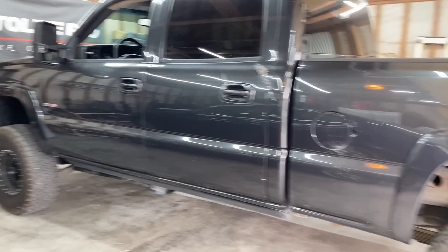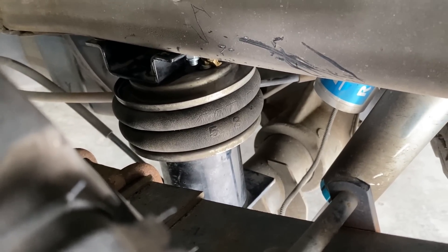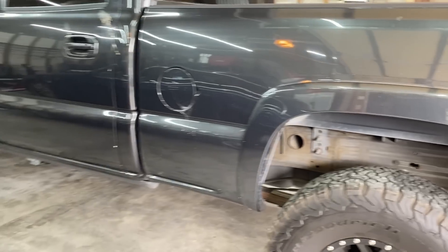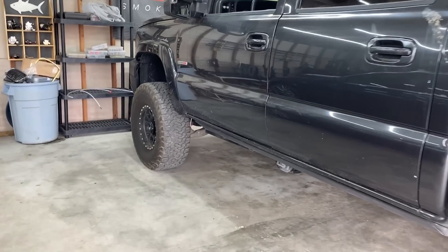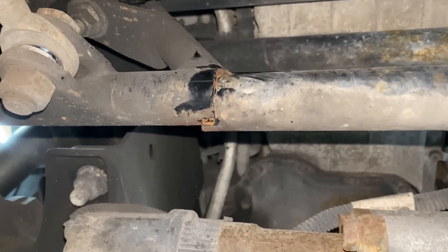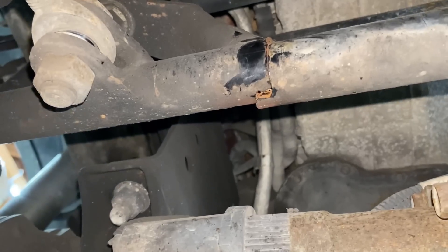I would call that a good day. I'm happy I got those airbags back in the rear end — the truck is actually sitting a good bit higher. I have those bags with zero psi and they are completely collapsed and sitting flat, so it might actually affect my down travel too. But it's a tow rig now, and she's going to be getting used to haul trailers, boats, and all kinds of stuff around the northern half of the state. My steering is still snapped in two pieces though. Center link snapped in half. I don't know if I can weld it in the car — if I turn the wheel I can shift it and get it to straighten out perfectly again, but I don't think I can weld it in the car. Maybe — I think I might be able to with John's help. He's a pretty pro fabricator.